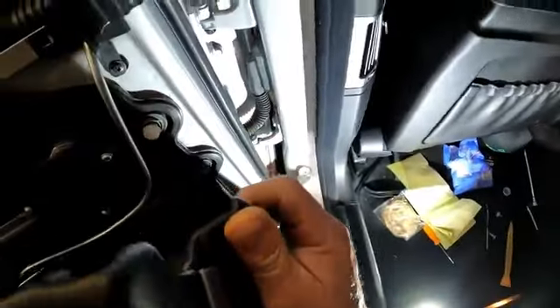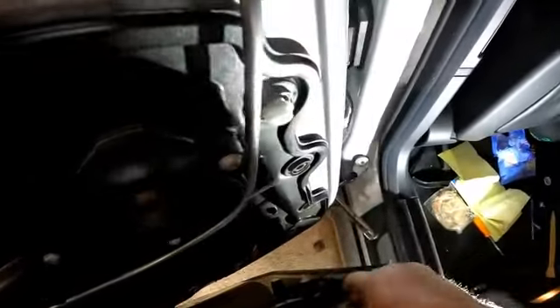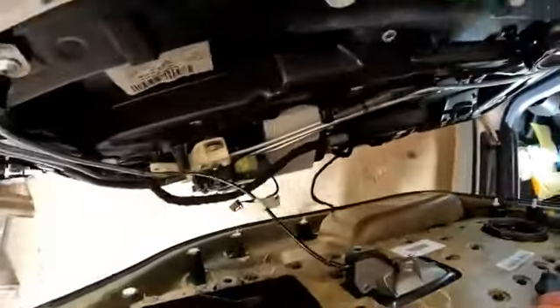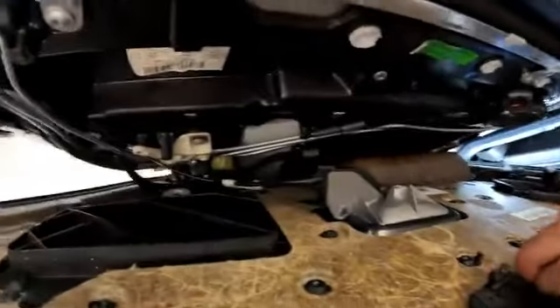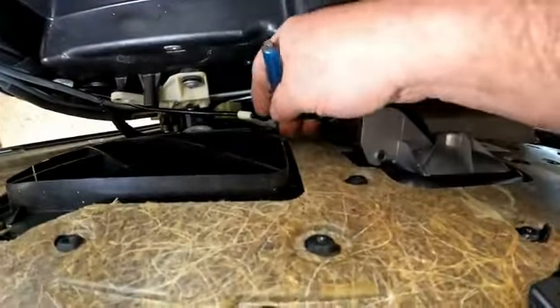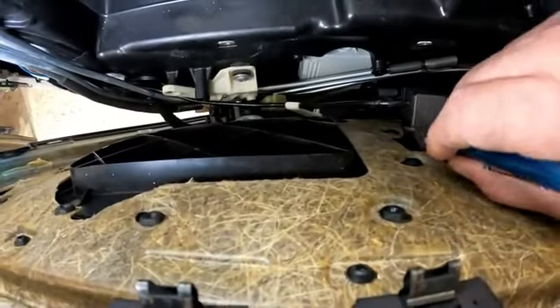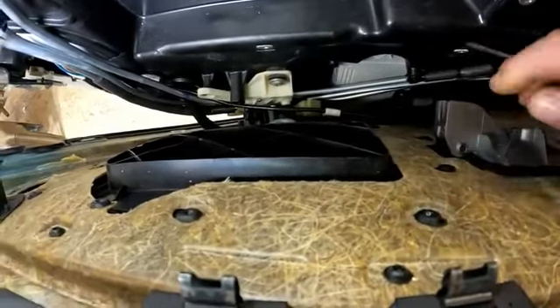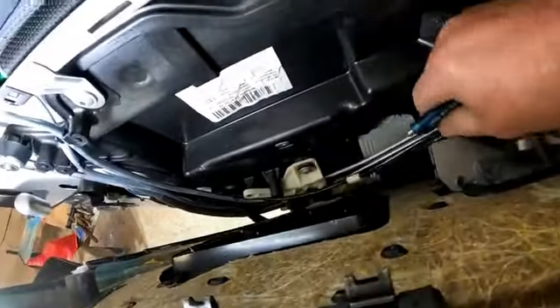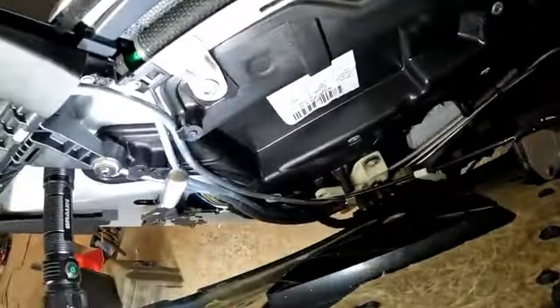See if I can finish pulling this door panel off. See these little plastic clips here — they need to be removed and installed back on the back side of the door panel. We've got an inside door handle cable here that needs to be removed. I'm just taking a screwdriver down in here on the back side of it, just lift up on it, and it popped right out. And we'll have an electrical connector somewhere.